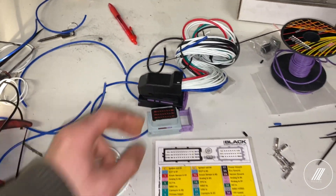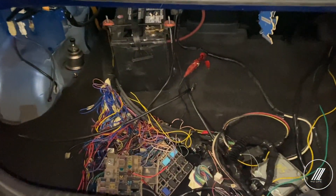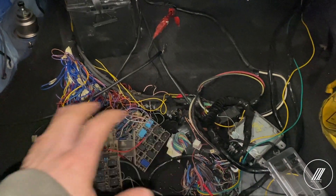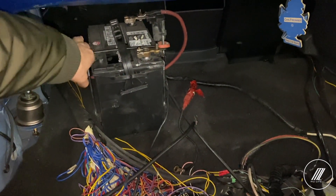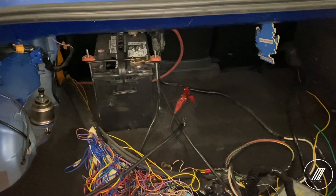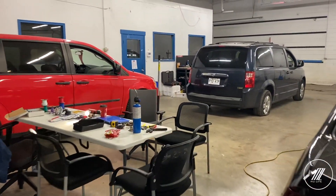I'm trying to create a new harness to make everything look clean. I'll show you guys how to wire up the connectors and then do the rest. After that I'm going to clean up the trunk, because the trunk is another story — ever since I moved the fuse box from the front to the back it's a little messy. The battery is slightly loose so I need to put some sort of tray under it. I was thinking of doing a race fuse box DIY, but I haven't finalized that yet. For now let's go do some connectors, pinning, and wiring.